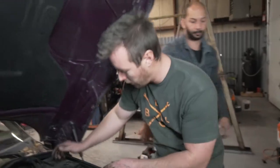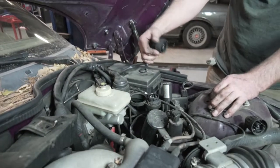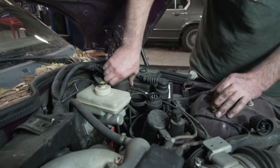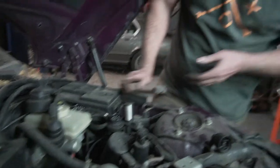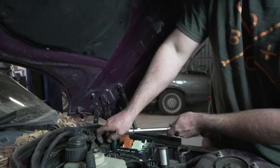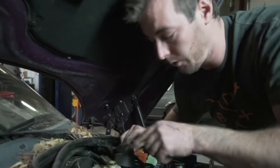First thing you're going to want to do — easiest places — right here. You've got two plugs; some of them will have three depending on if it's an ABS car or not. So you've got one here — turn it counter-clockwise depending on what part of the world you're watching this from. And then, just like an E36 — which if you haven't seen our E36 video, watch that too — this right here is power for your fuse box. Now we've got that ECU hot wire off, which is what one of those wires is over there.